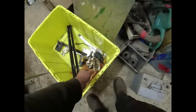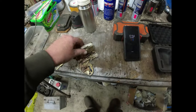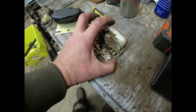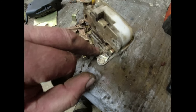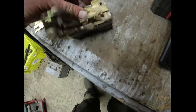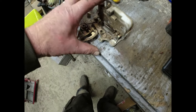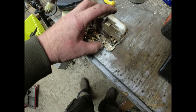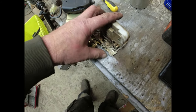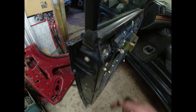If I look at the rear door catch - bear in mind this is a rear door catch, that's a front door catch - here's the lock mechanism. What would normally happen is that would stop the catch from undoing, and the spring is there. You can see that's got a nice positive action to it, even though it's come out of a rusted door, which this one hasn't - which is why they put the spring on there to pull the plunger up.